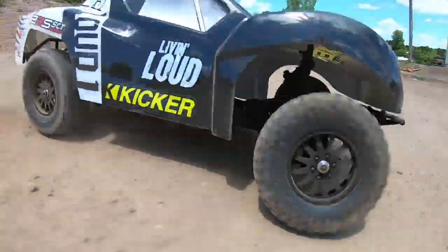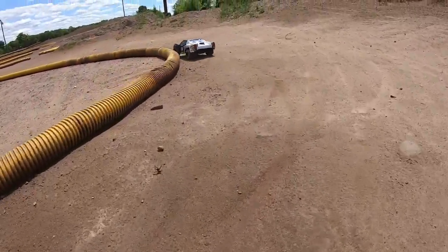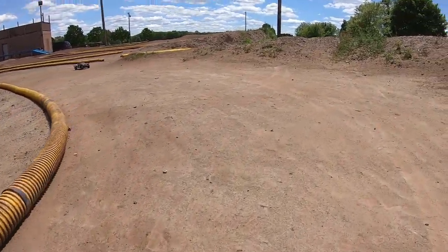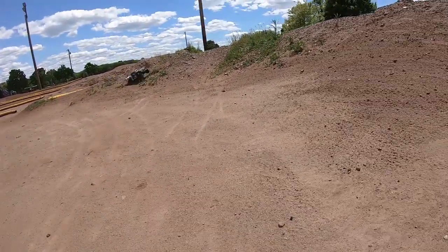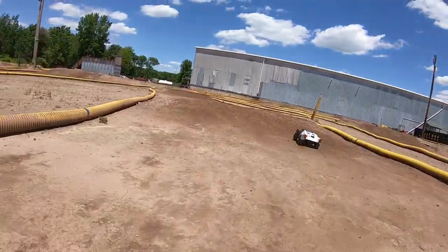I think the steering is kind of neutral. It was hard to tell because there were some tire and differential issues with this thing. That differential that felt so smooth on the workbench, the grease kind of separated inside the differential, and so now the differential just spins nice and free. There's no friction on the inside, so it kind of diffs out as you're pulling the throttle.